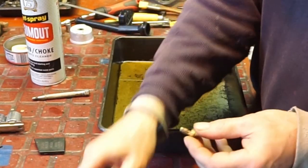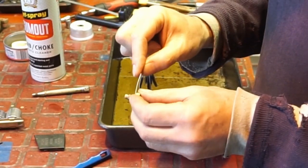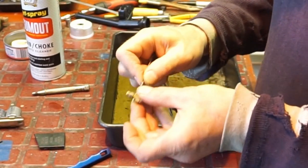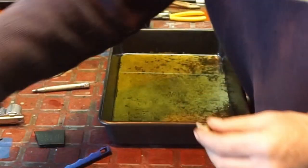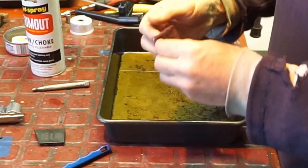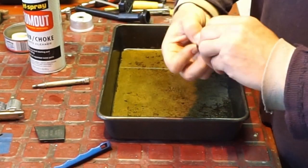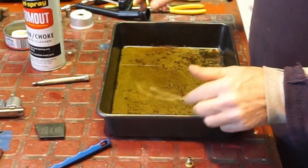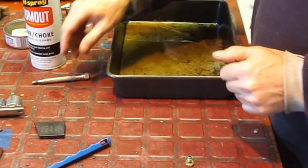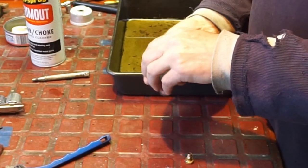I do see some gook — not a lot. I had this soaking in a little bit of acid for a bit. Let's grab our Scotch-Brite, give it a twist. Now the main jet — I like to drill them out because I'm here at sea level.